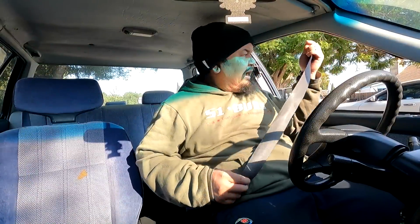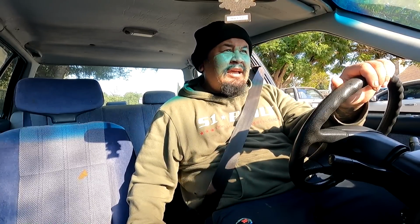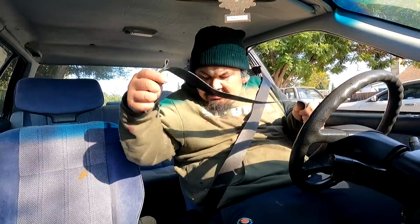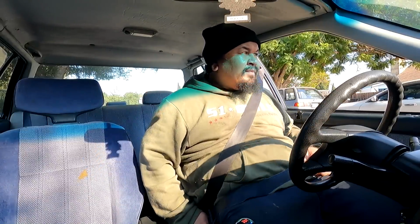Hell yeah, brother. So right now, I'm about to go for a drive. Just a drive, because I want to make sure everything with the drive shaft is all good and dandy. No weird noises, vibrations. And if everything feels good, maybe we'll get into a little throttle, but I want to make sure we check everything out first. Got the lap built, and let's go for a spin. So something with my steering is a little weird. It feels like it torque steers a little bit, and it feels super light in the steering.